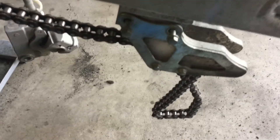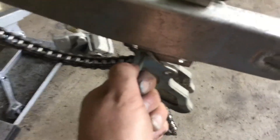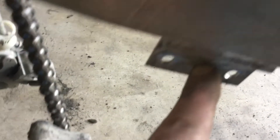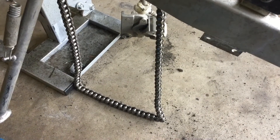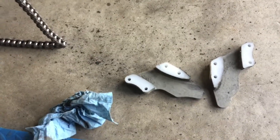The rear tire's off. To get the chain guide off, there are two 8mm bolts right here — I've got mine loosened so I'll just pull those out. You can see it comes off. To get the chain completely out, you take these two bolts out here and this will separate. It goes on this welded-on piece on the swing arm. All four bolts are out of the chain guide and it's totally free from the chain. There are just two halves — a plastic piece and a plate. The plastic piece is a wear part you can order and replace.